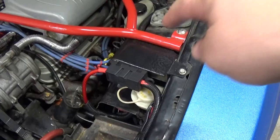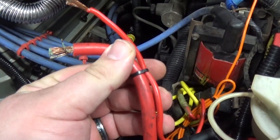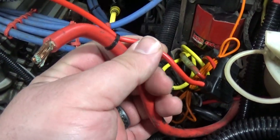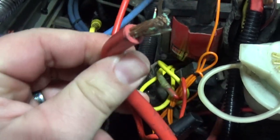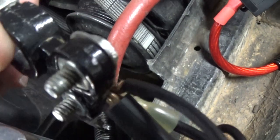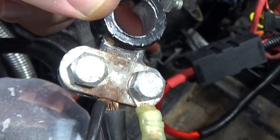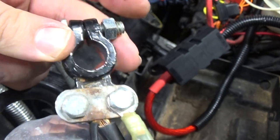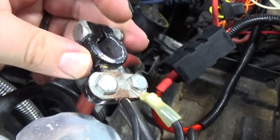Let's go ahead and remove the battery - removing the coil cover first. We're going to remove this power wire here. This goes to the positive on the battery and connects to the left post on your starter solenoid. I have power here for my electric fan - I'll cut that off and recrimp a new lug terminal on it. You can tell here it's corroded - just look at that corrosion. A lot of these temporary AutoZone battery terminals are not the way to go. You can see it's already starting to rust, and any rust is going to give resistance to your grounds or electrical system.